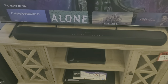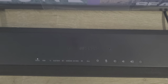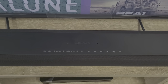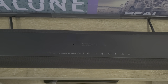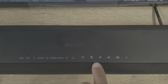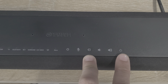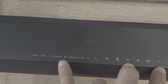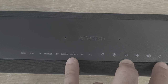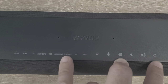What you do is the soundbar has to be turned off. Right now it is currently on, so I'm going to hit the power button to turn the soundbar off. We see 'switching audio to TV speakers' — that tells you the soundbar is off and we're now using the TV speakers. When the soundbar is off, you hold down the input button, then push the power button and hold it down for up to five seconds. When the feature is disabled, the clear voice light will light up, and then the soundbar will turn on.